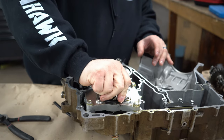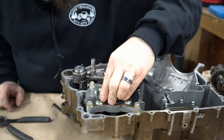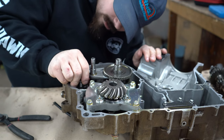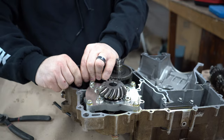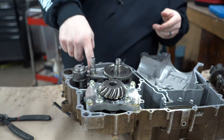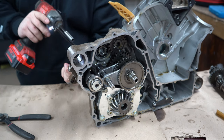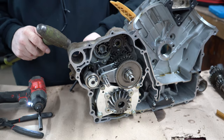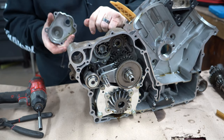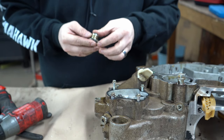There's park — that's what he's talking about. He said it doesn't want to go into park. So if we can figure that out... it feels like it's all the way in — oh it's all the way in because we can move it all around. I do see the crack down here. Let's see if we can get that apart. I'm gonna pull this apart. Just a little bit of a love tap there. That seal should be replaced. We're going to pull that out and set it aside.